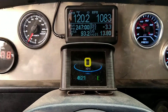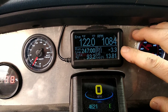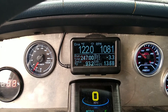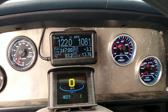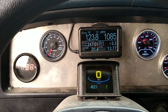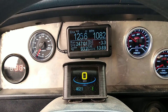I want to give you guys a view of the gauges before we get started. The important stuff is obviously going to be the EGTs. This ultra gauge at 5,000-foot elevation — you can see I'm reading negative 3.3. So just to give you guys an idea, I pretty much have to make 3 pounds of boost before I have none. You can see the elevation on my speedometer there: 4,600, and we'll go up to just a little over 5,000 on the way home.